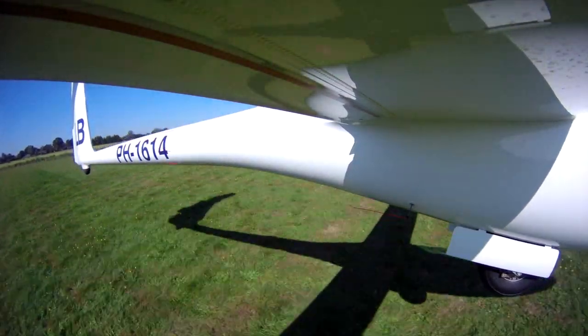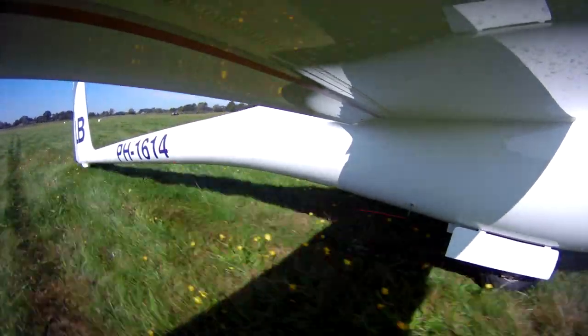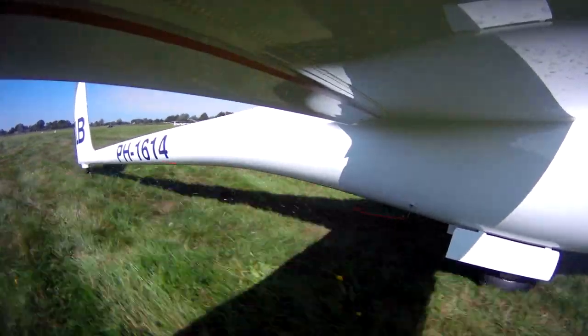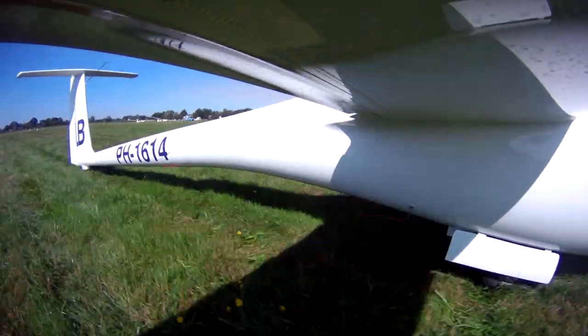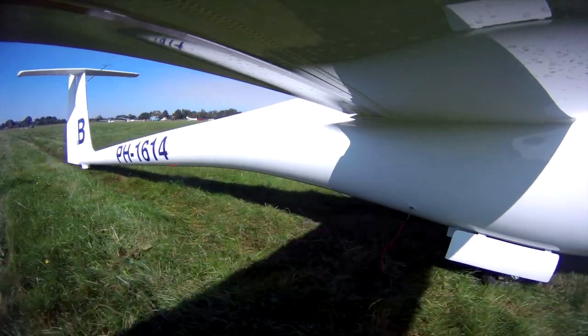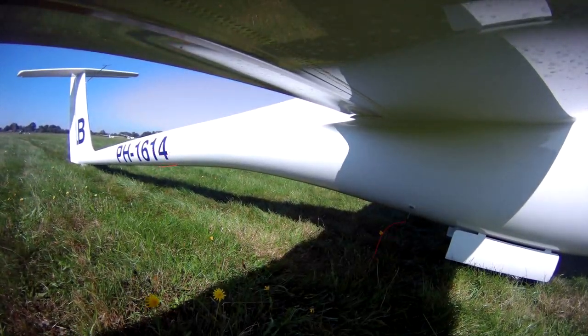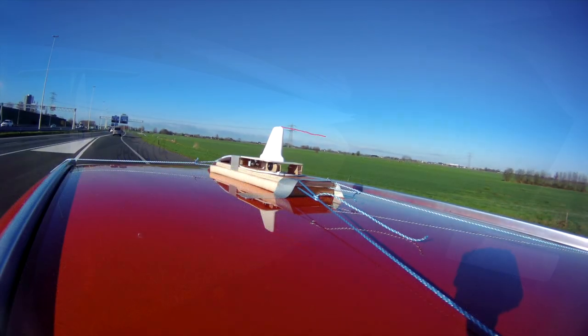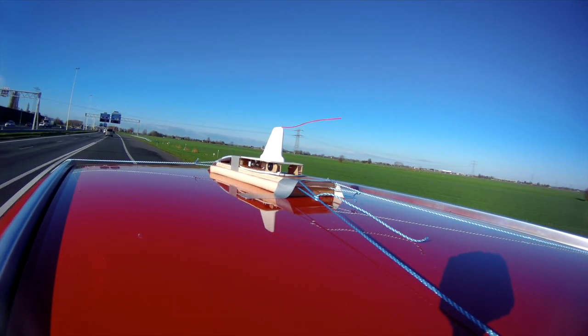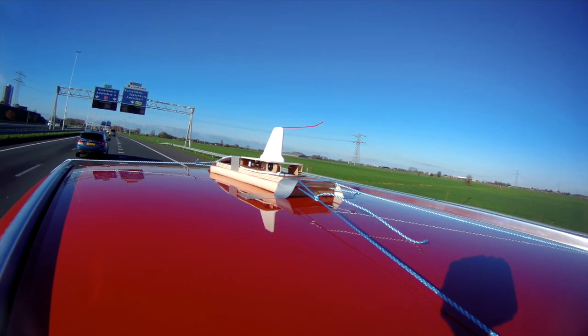By this time I decided to mount the rod-type antenna in place of the wing antenna. But after all this testing, I was curious about the amount of drag produced by both antennas. The wing should be more aerodynamic, but the rod-type antenna has a much smaller frontal area. To test this, I made a test setup with a load cell and an Arduino on the roof of my car. I then did some tests at 100 km/h, driving in both directions to compensate for wind.